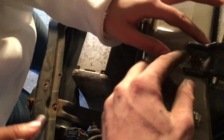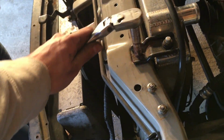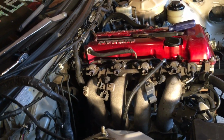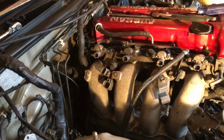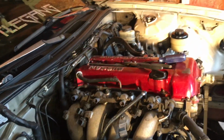Oh, it's stripping? I don't want to break it. Yeah, I'll do it in a second. And then all that's undone, power steering. So we're getting close to pulling it out. The last thing that's going to need to be done, let me see. I'm just trying to get the rest off of it so it'll fit. Oh, okay, that's fine. So the last thing that's going to need to be done is basically I need to slide under there with the thing and undo the trans mount and the drive shaft. And we should be ready to yank this thing right out. I haven't figured out where I'm going to hook up the engine hoist yet to jack it up, probably somewhere around the intake and the exhaust, and that should balance it out pretty well.